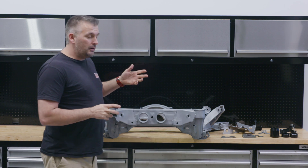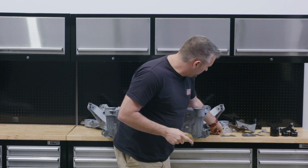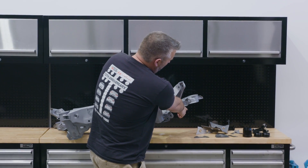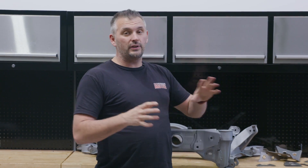It's actually really simple. Basically, we get the front lower control arm pickup point and we add another one about 20 to 30 millimeters lower down, depending on which model. R32 lower control arms sit quite aggressively for anti-squat, and an R33 isn't as bad, so we don't need as much adjustment in that front lower control arm. It's a mod we did to Jet 200 many years ago and helps with traction. Essentially, a new lower control arm pickup point on any Silvia or Skyline is going to help with traction by helping it squat more, because they have anti-squat built in from factory. If you look at an S13 versus an S15, or an R32 versus an R34, they're totally different — over time Nissan took that anti-squat out of the car, which is why the subframes are a bit different between each model.